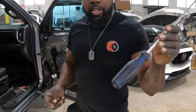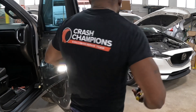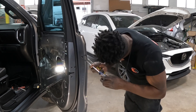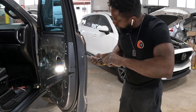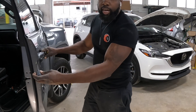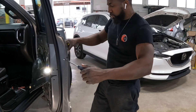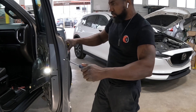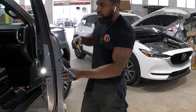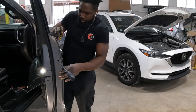It's a T25 — you need the T25, the star tip. Take that screw loose, turn it to the left. Turn it all the way. When it gets stiff, stop it — with your screwdriver slowly pry it out.